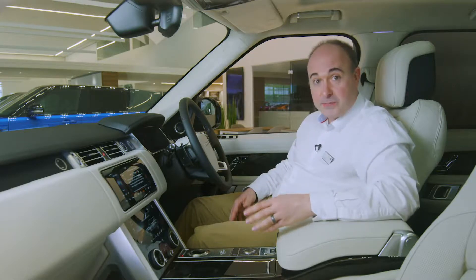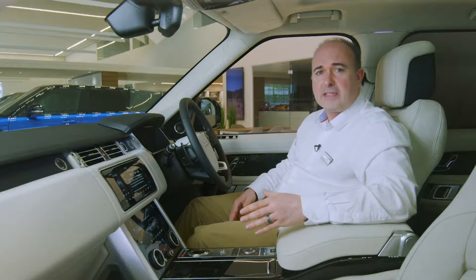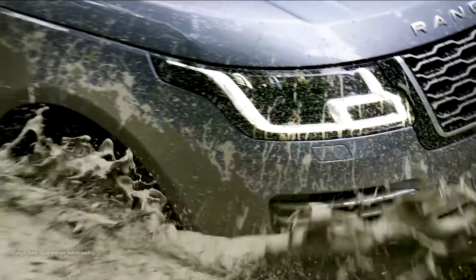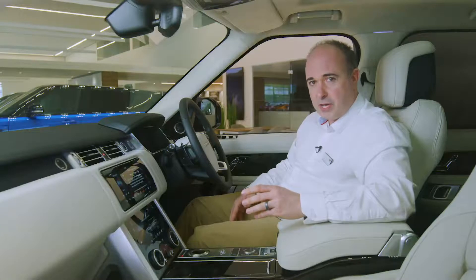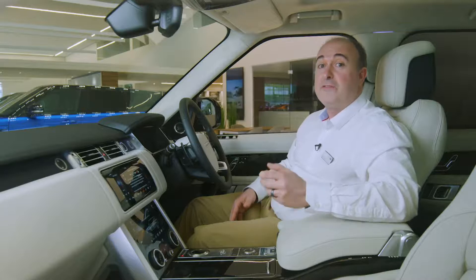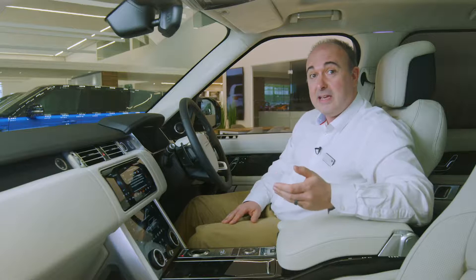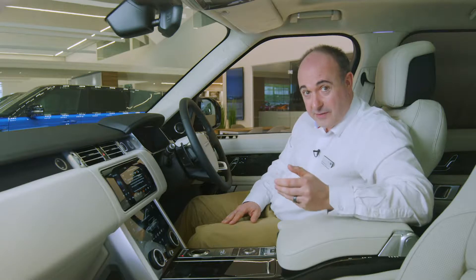Range Rover's variable height air suspension can be controlled from the next cluster of buttons. Range Rover descends 50 millimetres to allow easier access getting in and out of the car, and can rise up 75 millimetres from normal drive height to give maximum ground clearance over rough terrain and enable the full 900 millimetres of wading depth. The rear suspension height can also be controlled using the switches in the load space, which can make loading the boot or hitching a trailer easier. You can even control the suspension height from the smart key — with the engine running and hazard lights activated, close the doors and press the headlights and tailgate unlock buttons simultaneously to lower the suspension, headlights and unlock to raise the suspension, and headlights and lock to set the vehicle to normal height.